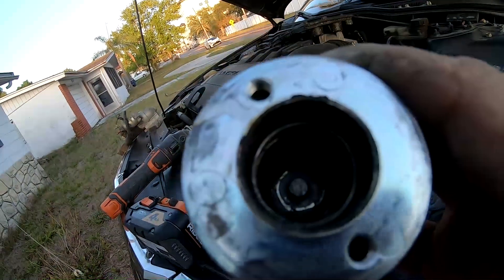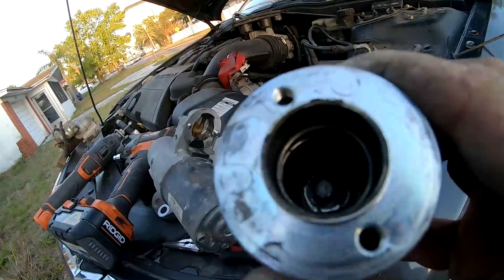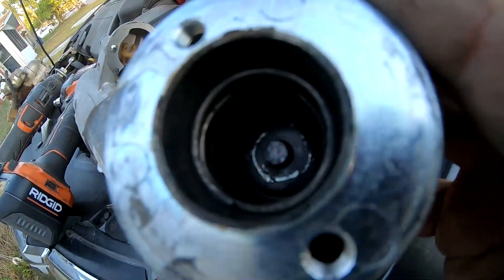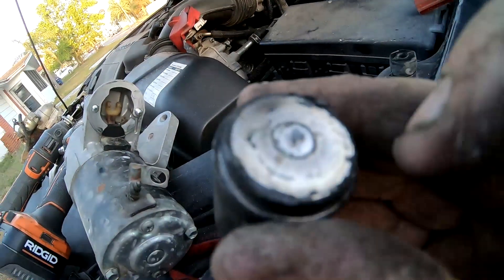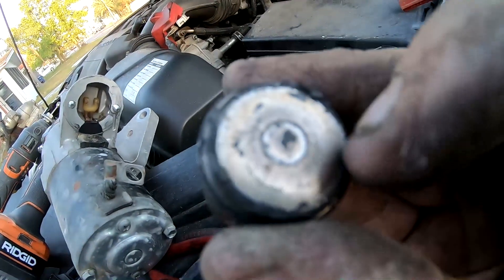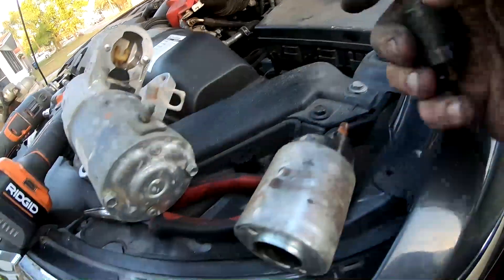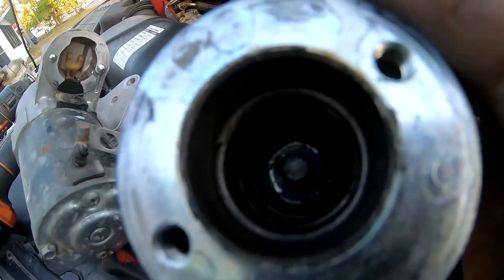That pin in the middle transfers power, and this pin had a whole bunch of corrosion on it — I had to chip it away. I'm going to go one step further and use a Dremel to clean it until it's shiny. The other part here also has buildup on the center that I can feel — that buildup is preventing a solid power connection. When I'm done, both this and the pin inside are going to be clean like brand new. That is actually the problem with this starter — it's not the starter itself.